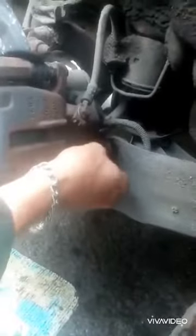A 16mm socket goes on the nut here, behind the bracket. All you do is give it a good punt to break the taper, and then it's just a matter of winding it out. And that's your first nut off.